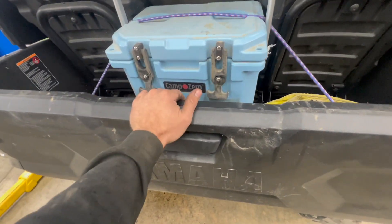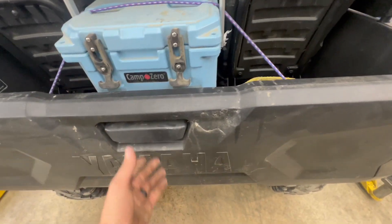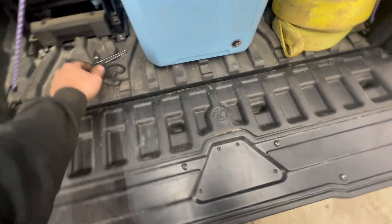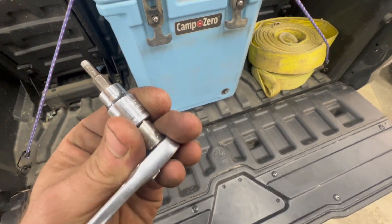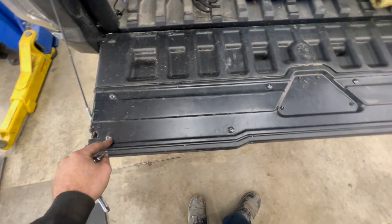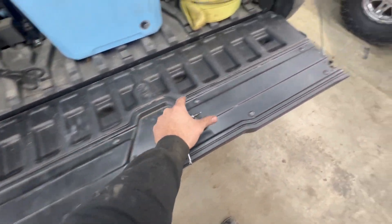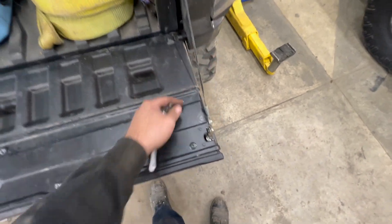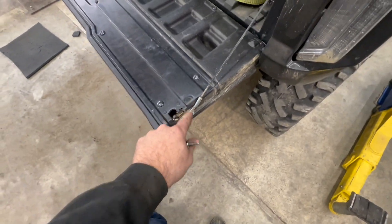Because it's a tight fit closing, I'm going to pull this back apart. You need a four millimeter allen to get all these out. You've got two, four, six, eight bolts, and your tailgate will drop because your cables are attached to what we're getting ready to take loose here.